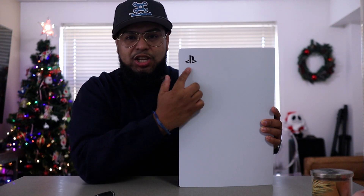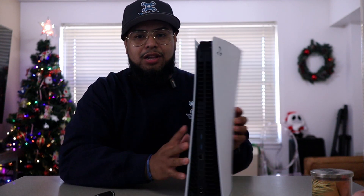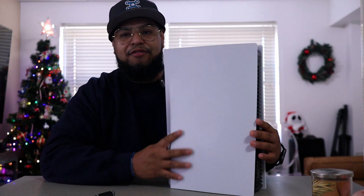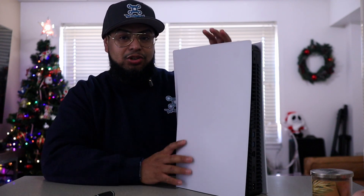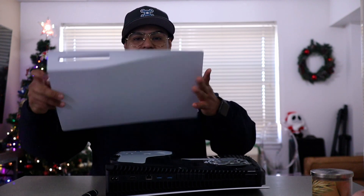This right here is not the side you want. The side with the PlayStation logo — that's not the side where it goes. Where you have your disc drive, or where it's more puffy on this side, this is the side where the SSD is going to go. Simply flip it over, push on this corner and pull on this corner. There we go — voila, we are in.